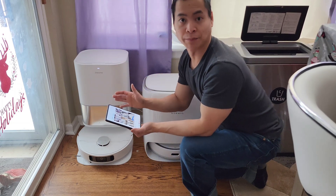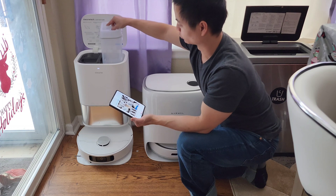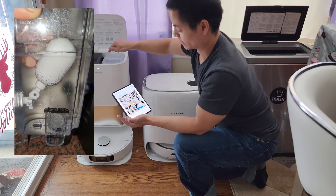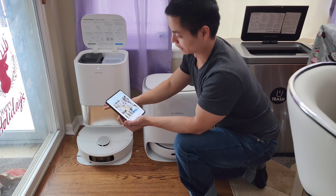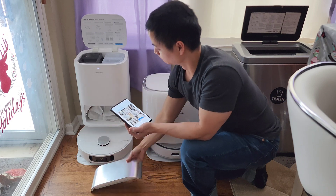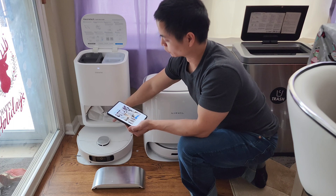Let me talk about what you saw in that short video clip. Basically, this auto-empties the dirty water tank as it refills the fresh water tank. You may notice there's a little ball or check valve — once it rises up it will actually shut off the fresh water so it doesn't overfill the tank. The self-emptying process is the same; it washes the mopping pad. The self-emptying system uses a bag right here, and he hasn't touched that. Down the road he'll probably figure out a way to hook up a hose instead.